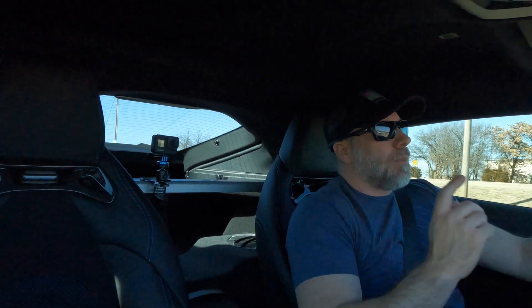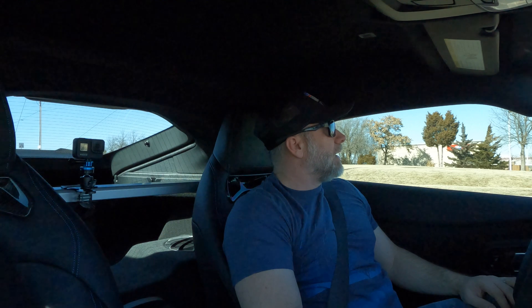I just fueled up. I'm going to drive around a little bit to see where the E-content averages out and normalizes, then we'll go from there. We're going to jump on the interstate and go out to a closed course where we'll get some pulls in. For today, there's no need to pair this with a Dragy pull — a lot of times I'll do a 60-to-130 or 40-to-100 Dragy pull to see how it compares. But today we're just looking to make sure we have solid logs, fuel trims look good, boost levels look good, and it's running right — see if there are any tweaks to make before we get it on the dyno.